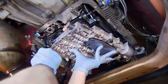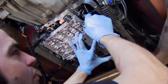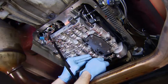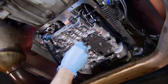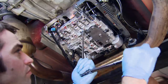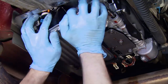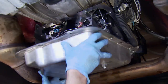Keep in mind this truck and transmission has 100,000 miles on it, and the wiring harness and its connectors have seen plenty of heat, so they might be a little brittle. Use care when plugging things back in and make sure you don't pinch the harness between the valve body and the case. Also, don't forget to hook up your manual shift valve or you won't be going anywhere. When tightening down hardware inside a transmission or engine, we're sticklers for using a torque wrench. Not only does it prevent warpage from overtightening, it prevents stripping out threads inside aluminum parts. If you're going to do work like this, it might be a worthwhile investment to pick up a small inch-pound torque wrench. We're also installing a new transmission filter and a new gasket that sits up inside a bore in the case — it can be a bear to replace, but we did it anyway.